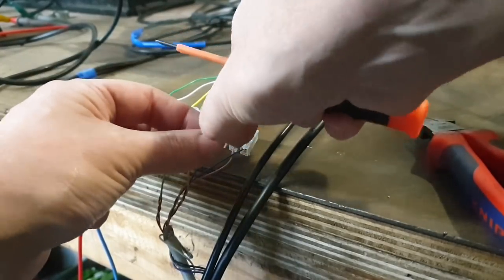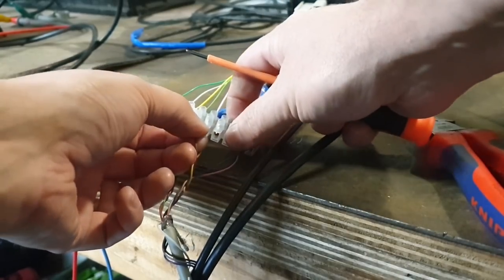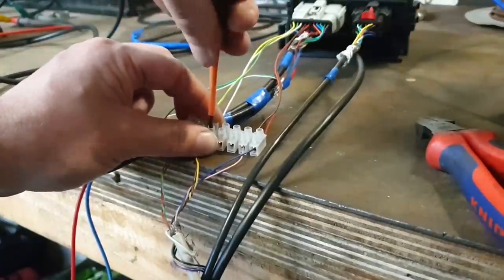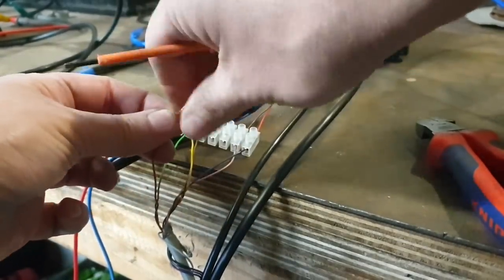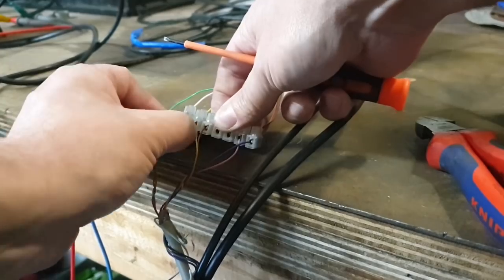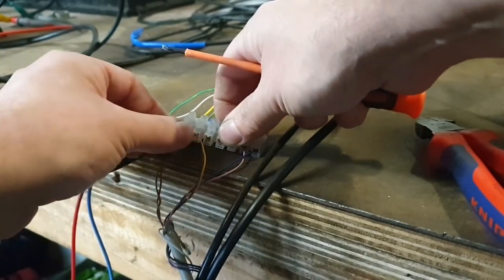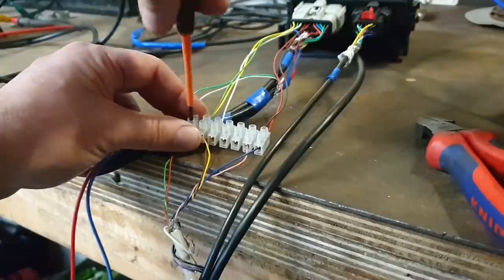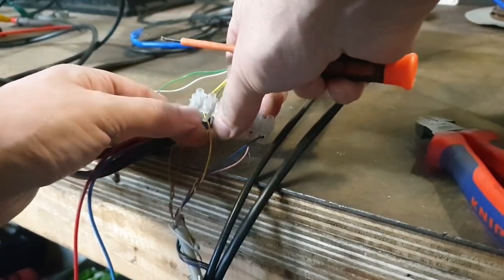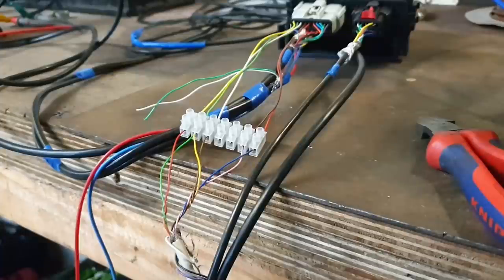And then we're going to take our other two and just choose whichever one we want to connect here. It doesn't really matter for the purposes of this initial setup, because as I say, we only have a 1 in 4 chance of getting this right from the beginning. And trust me when I say, I'm very rarely, if ever, that lucky with these sort of things. So I'll connect this guy here. And that's it. That is our initial resolver connection.